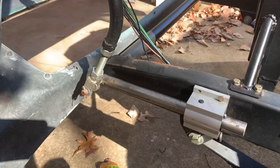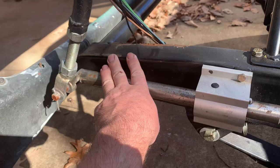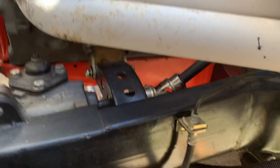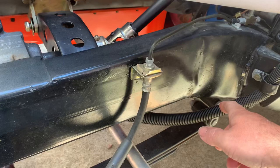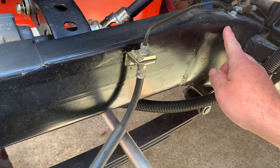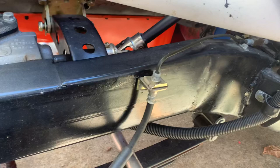I made another video where we bull-nose the front of the frame rails — that'll be coming because I'm about to build some more. What you end up with is this piece that you cut out — I ended up putting it back here. It blends the frame rail and makes it taller, maybe five and a half inches. I drill in here with hole saws to plug weld, and some guys put a gusset on the bottom too. This piece added a lot of structure.